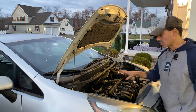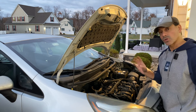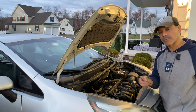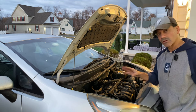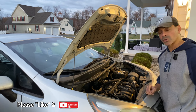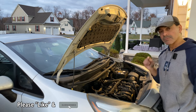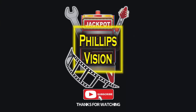That wraps up this video. I was just doing this quick project and wanted to film it and post it for all of you. If you're getting a catalytic converter code, rather than spending the money on the catalytic converter, if you have one of these borescope cameras — if not, you can pick them up fairly inexpensive — they come in handy. Just take the upstream O2 sensor out, feed it down in there, and take a look at exactly what's going on before you spend the money. I hope it was informative and helped you out. Please send me any questions and comments — I appreciate all the support. Please like the video, subscribe to the channel. I'll see you next time.